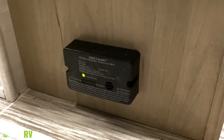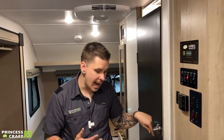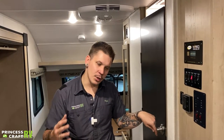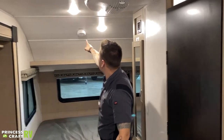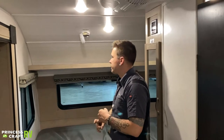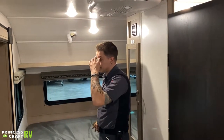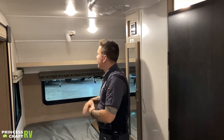Down low here, we have your second piece of safety equipment — the carbon monoxide and LP leak detector. It will alarm you to the presence of either gas using a series of light flashes, with the scale written right on the appliance. It has a test button — test it every time you take the unit out. It is wired into the 12-volt section of the camper, so there's no battery to change. The smoke alarm up top does run on a 9-volt battery — check it every time you take the unit out and keep a spare battery on hand. If you're like most people, that alarm will start chirping at 3 a.m., so don't remove the battery — just replace it.